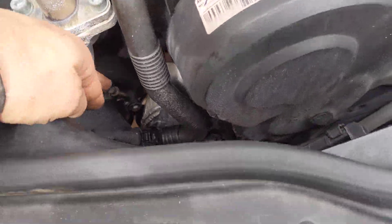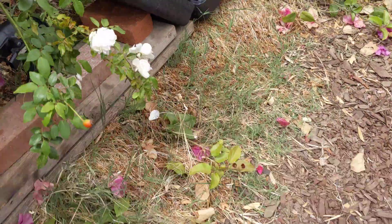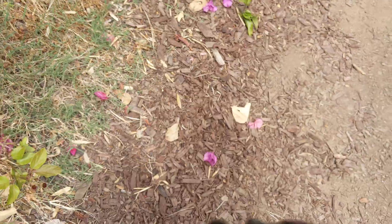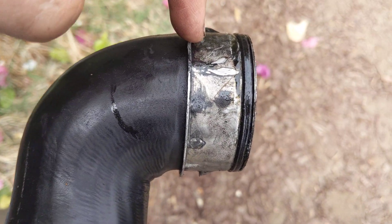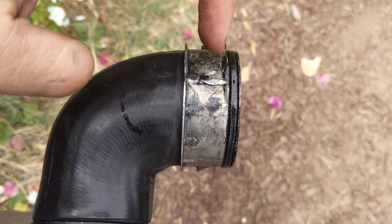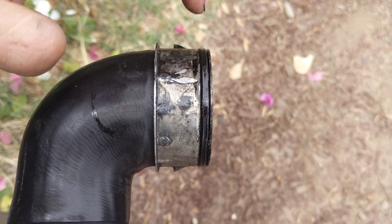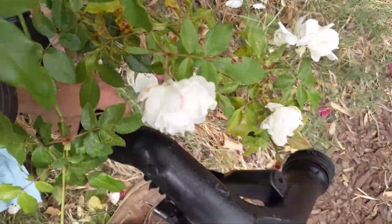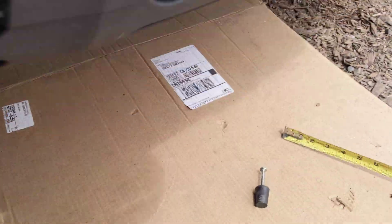When I did this, I found a bad o-ring. There are o-rings on these intake tubes - each metal fitting on the end of the rubber tube has an o-ring, and it's actually an X-shaped o-ring that sits in a groove. The o-ring on the bottom, on the exit side of the turbo, was bad.